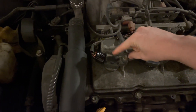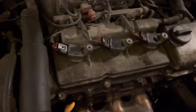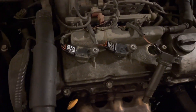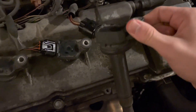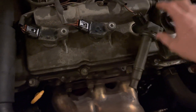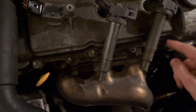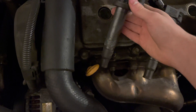A set of coil packs — this is a V6, obviously, so there's six of them. From the parts store it would have been $320 from AutoZone, and they stayed around there at all the other parts stores. These are the original coil packs, and sometimes they last the lifetime of the vehicle, sometimes they don't. With these Toyotas, misfiring from the coil packs was an issue with them, so it's very common for these to go bad.